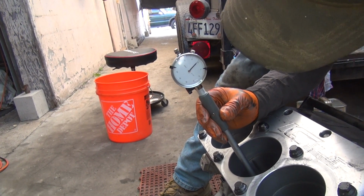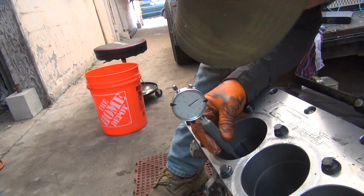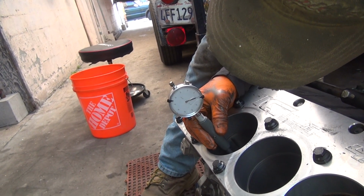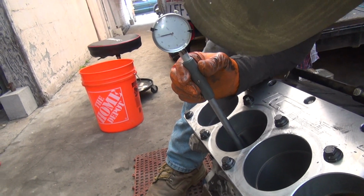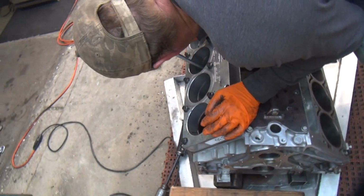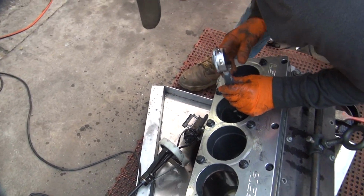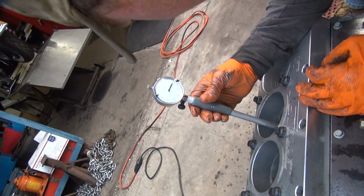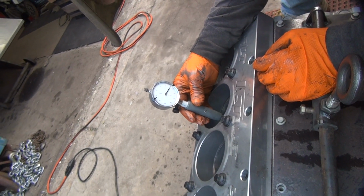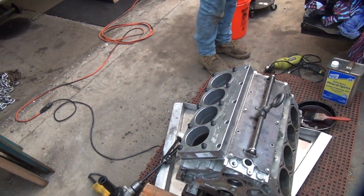Oh, that's way too big now. Oh, there it shrunk. Okay, go all the way down. You're not down yet. There you go. Okay, you're still just under 4. More at the bottom. Okay, bring it all the way up. You still got material to work with there. 3, but you took a lot out. Turn it 90. Let me measure this groove I cut. If you do it upside down, you can't see anything. Okay, we're good. 3. About 4 1/4, more at the bottom. So we got about a thousandth still in there. We only took about half out of what we got.